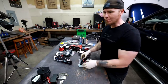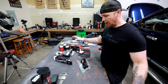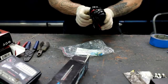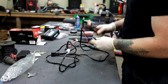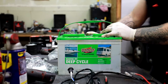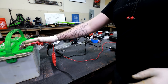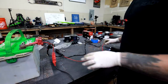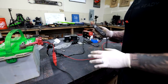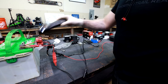We'll see once we get to that point. But right now I'm going to open up these relay systems, spread them out, and figure out exactly how I need to route each wire. This first harness is the one we're going to connect the rear battery to the front battery. I pulled the battery back out of the back because it's going to make it easier to figure out how to hook this up. I don't exactly know how to hook this up, but I know that with a power probe I can very easily figure it out. The power probe is hooked up positive and negative, and now it will tell me what is positive and what is negative.